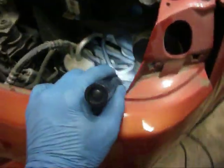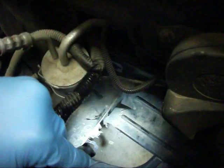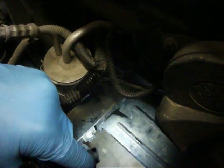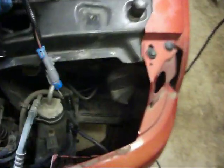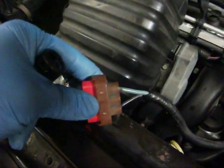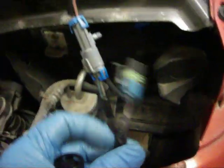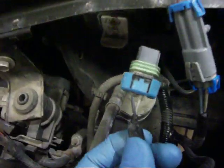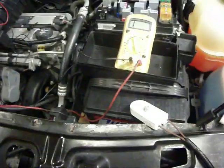The resistor is located under here, in front of the driver's side just behind the light — it's actually mounted way down under there. There's another one here we can get to and see. If you take a look at the wires, you'll notice one of them is blue, just like the other connector, and it's a different gauge — definitely for some current flow. This connector is black and white, and that wire is much smaller; it's not going to handle the current the other one will.